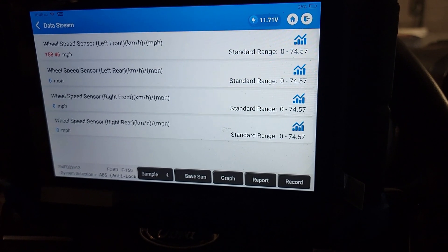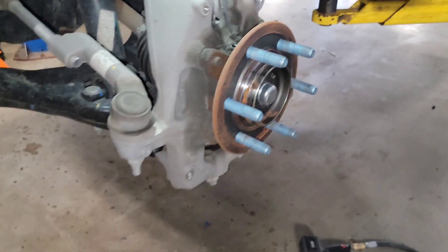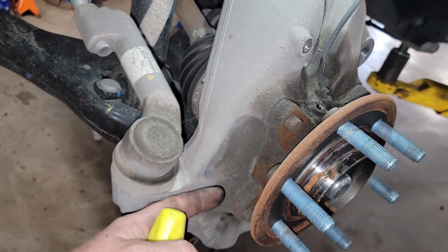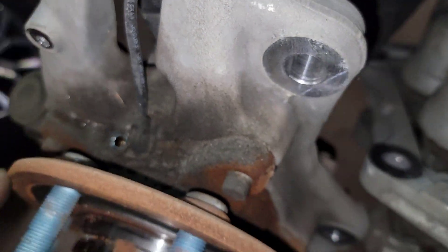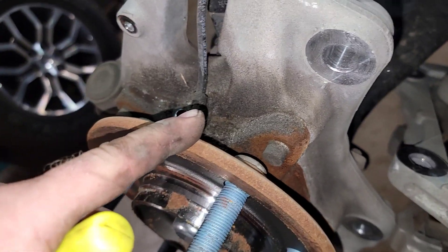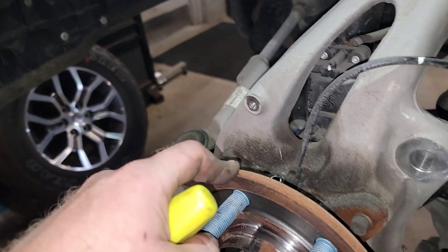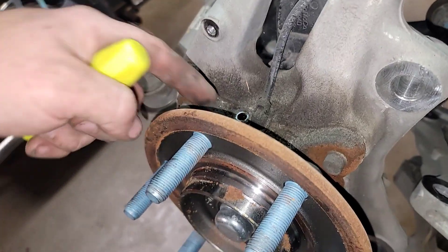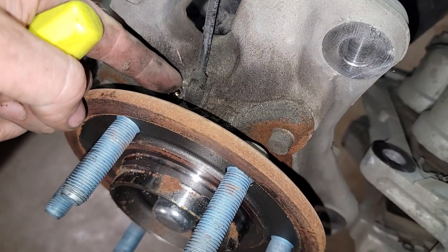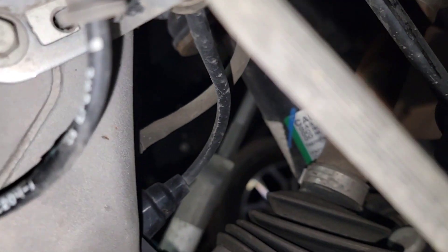Let's do a visual inspection and check it out. One of the things I'm noticing while I'm taking this apart is there's a lot of fluid — a lot of grease coming out around this. I took the caliper and everything off, took out the 21-millimeter bolts that hold it on — they were really tight — and took the H5 Allen out, and now I'm going to try to wiggle this out to look at the tone ring and stuff inside.